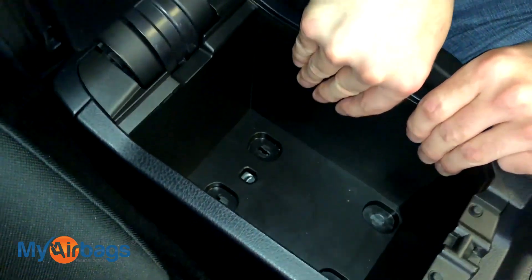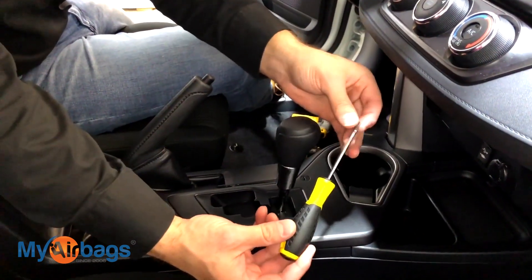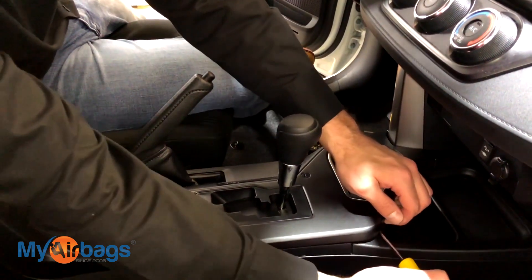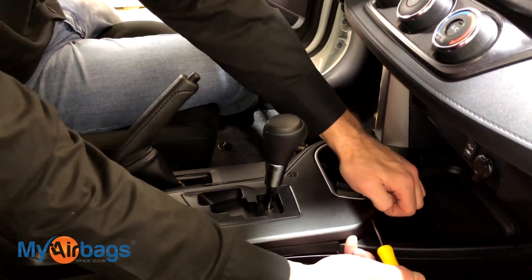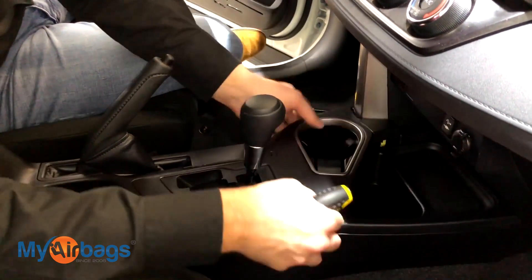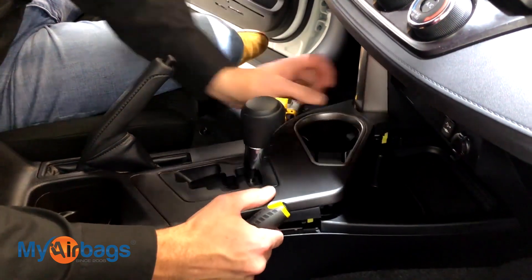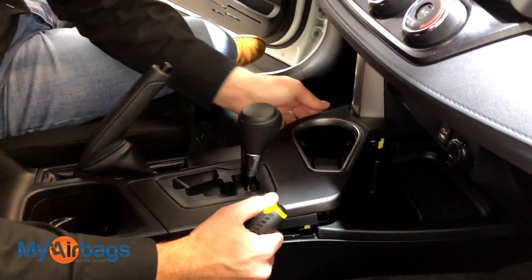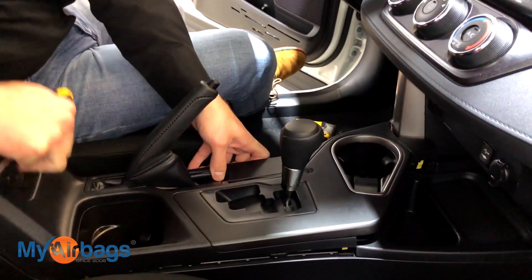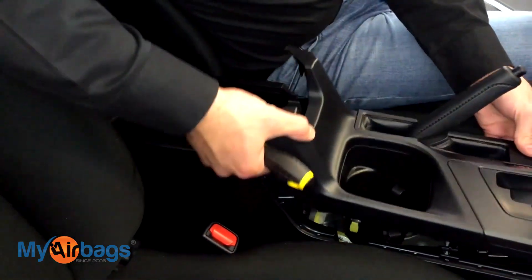At this point the back of the console will kind of be free and you can lift it right up, but we're not finished just yet. Next I'm gonna take my flathead screwdriver and start working this area right here. If you get right in between there and gently work this up, you'll notice it will start popping off — those are just tabs holding this trim down — and you'll notice this whole thing will start coming loose. Going to lift this up and work it just like that.